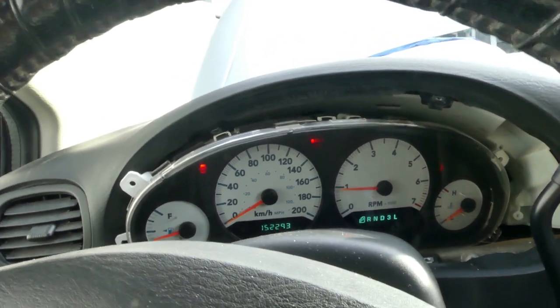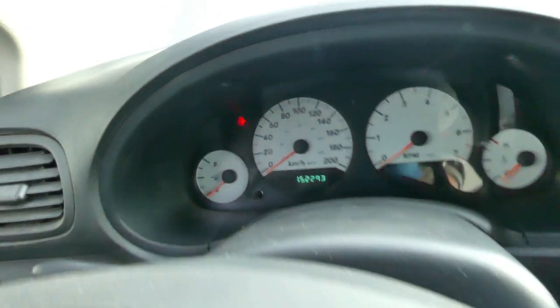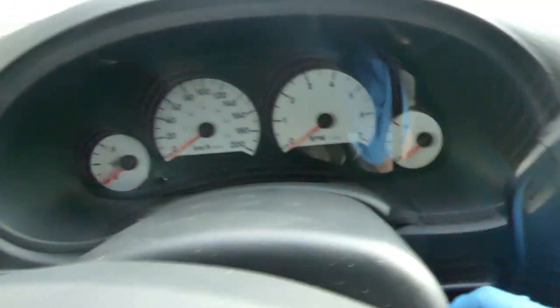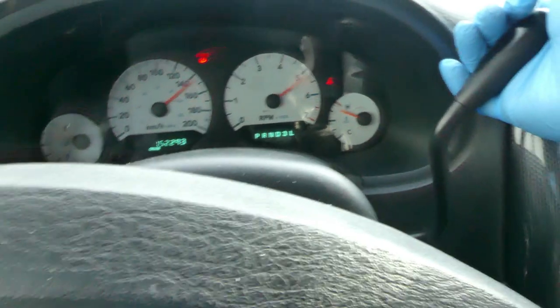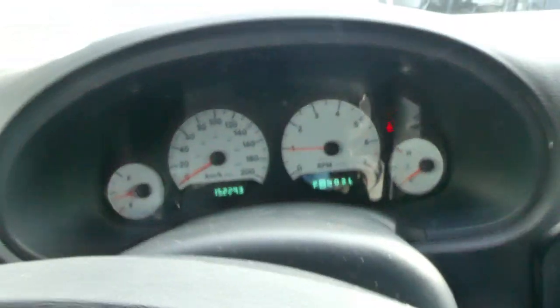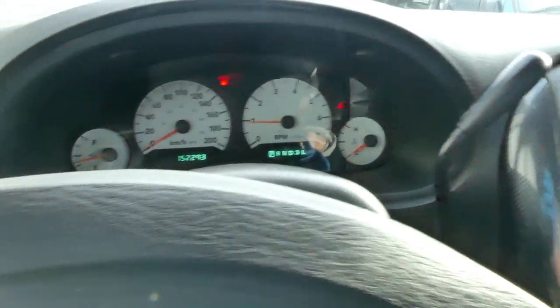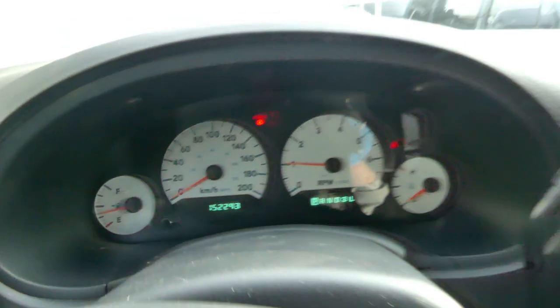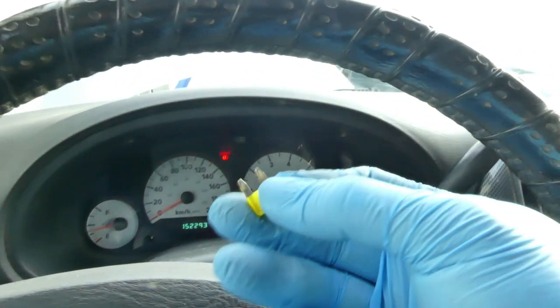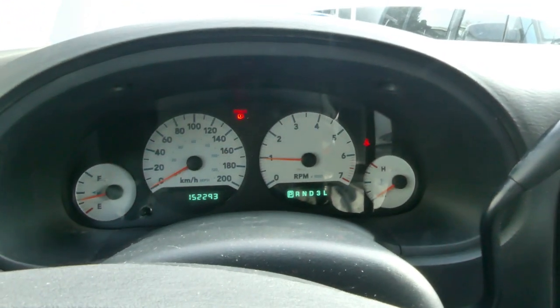Oh, I'm just gonna put everything back. Oh boy. So, alright guys. Everything is back. And the first thing I notice is when you open the door, you hear this chime sound and you can see right away this odometer reading. So it really works now. Let's put it on park. There you go. Holy smoke. Wow. Drive, park. Oh my god, everything works now. Just this fuse, the hazard fuse, 20 amps. Oh well. Lucky guess, but it works.